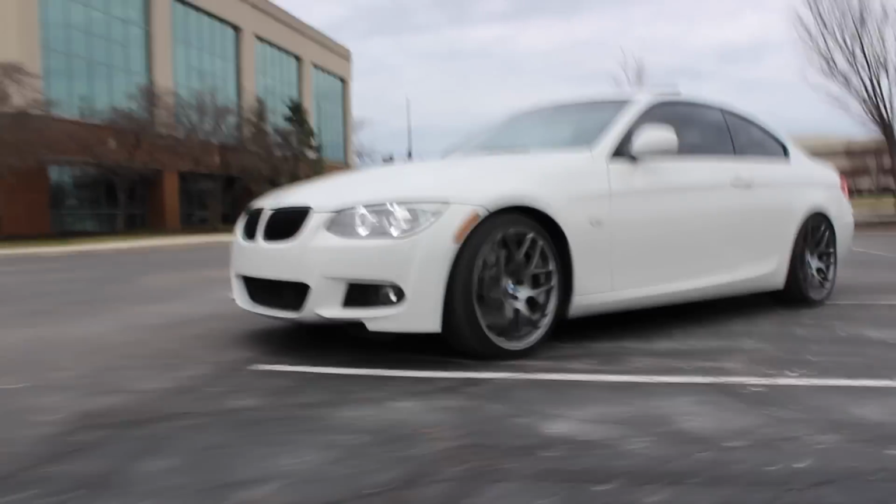And the last thing I actually almost forgot to mention is the width of the tire. I have 235s in the front, and I used to have 225s. So that's not a huge difference, but I don't want to have fat tires in the front because then it's just too heavy, and the handling, I'm not tracking it. It's just unnecessary. And then in the back, I had 255s, and I jumped up to 275s, which do rub, which I mentioned in other videos.